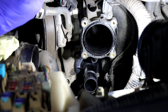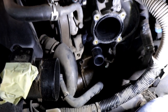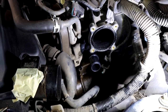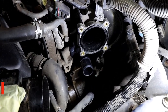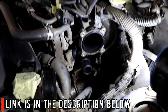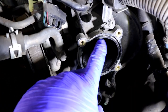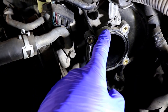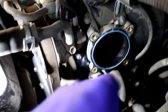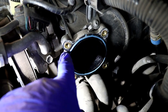The torque setting for these bolts is around 10 to 12 newton metres — that's what I found online as I couldn't find it in my program. Once that is done up, put all the coolant hoses back on, put the clips on, and reinstall everything. If you want to use this opportunity to clean your throttle body, please do — make sure all that black residue is off. You can use proper throttle body cleaner or brake cleaner. Make sure you put the seal in properly, clean out all the dirt, and ensure the rubber seal locates in the little hole.